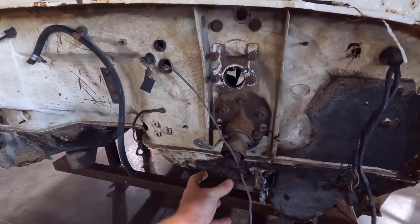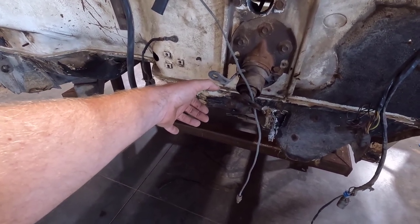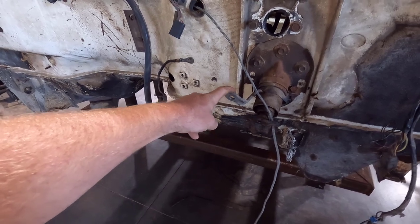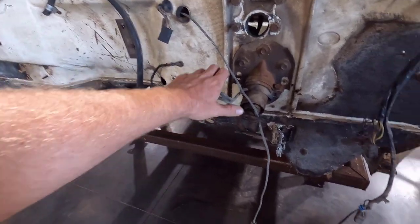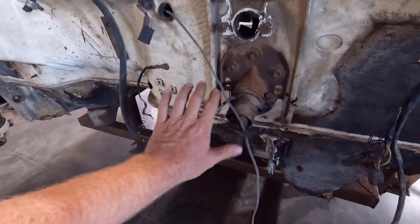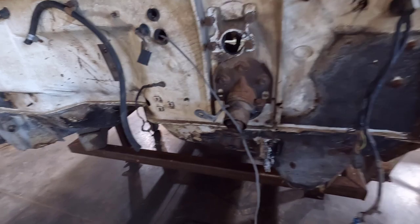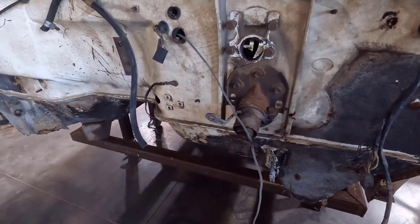The steering column was right at the engine — there's a fuel rail right here with a fuel rail pressure regulator on the back that regulates pressure. It was getting very close and actually bumping into the shift arm. My plan was, like I did with my Ultimate Highboy, to use a factory style steering column with a rod going down to the shifter. But this is hitting the valve cover and fuel rail, so I'll see if I can get it swapped to the other side. I'm also going to get rid of the rag joint and do a spline shaft like a highboy.